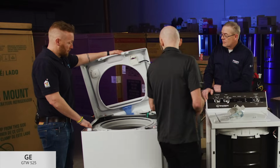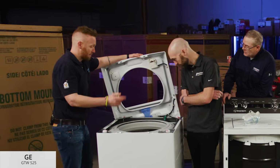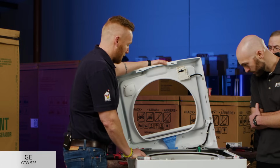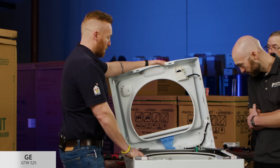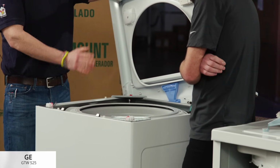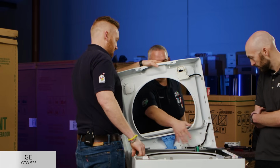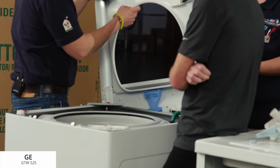So guys, I was able to get the lid pulled on this one so you can take a look inside, and like we knew, it's got the 4 suspension rods and everything that are braced up on top. A couple of things right off the bat that I really do not like about the unit is when lifting the lid, there is no way to support the top when you flip it back. I was able to roll a cart up to it just to hold it for now. I mean, you don't even have a disconnect to remove it. Nope. To be able to access it, this is very difficult to service.